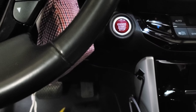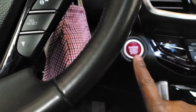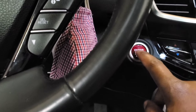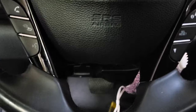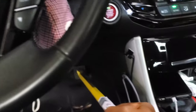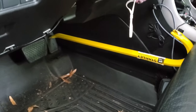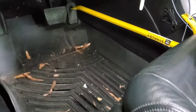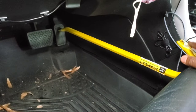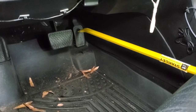In order to clean inside the throttle body, we have to press the power button twice but do NOT put your foot on the brake. Press it one, two times. Then we're gonna find something to push on the gas pedal. What I did here is I pressed it down and then moved my power seat forward so it's kind of squeezed against it — you get some resistance so it's not gonna go anywhere.